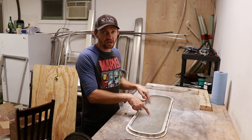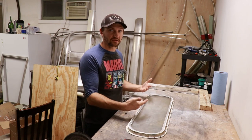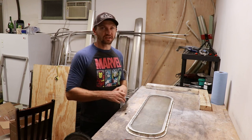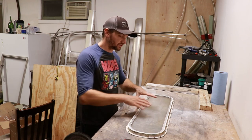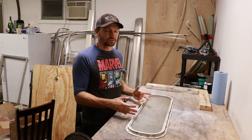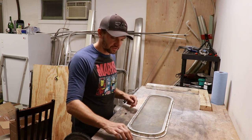These are actually not keeping dual pane, which is kind of weird. But one of the problems is that these were the only windows in my Airstream that had glass on the outside and plexiglass on the inside. The plexiglass, obviously being old, is just trash — all scratched up. I decided that if it was really cold or really hot, I could just put a piece of Reflectix cut to fit that opening. It's not going to block too much light and it'll create enough insulation to be even better than dual pane. So I'm actually going to restore them to just single pane.